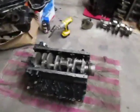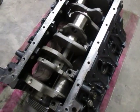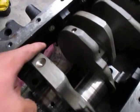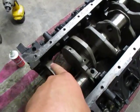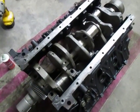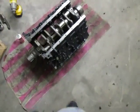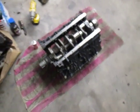So when you assemble a Duramax engine, after you have the rods and pistons in, have the rings seated, the rod caps torqued, everything torqued, go ahead and grab these piston squirters that cool off the pistons and adjust them and aim them to that hole. They're brass, so you can maneuver them and bend them, because if they're off, that piston is not going to get any lubrication to lubricate the wrist pin. And you could drive like that for a while, but once that wrist pin seizes up in the piston, the whole world's going to know it.